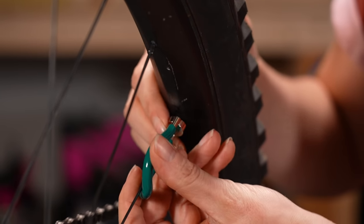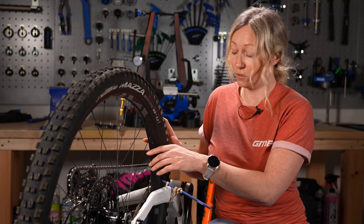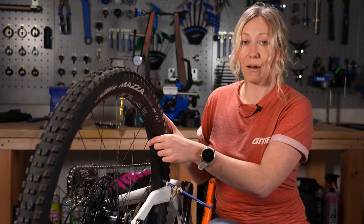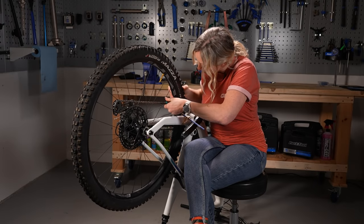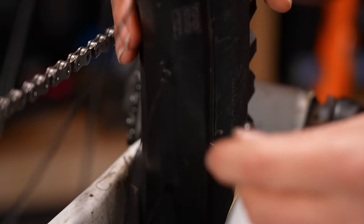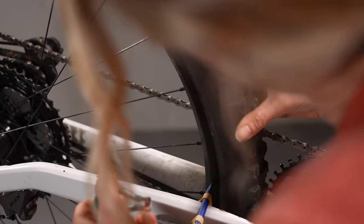Tightening that up half a turn was enough to move it away from the pencil. I'd always do a quarter turn or a half turn if there's a lot of movement, but it's better to go with a quarter turn first, then roll it back to the pencil and check if it's still scraping. If it is, carry on in quarter or half turn increments so you don't go too far in the opposite direction. This is the problem-solving part — checking whether it's going closer to the pencil or further away, and making tiny adjustments to straighten it up. A little backing off on that side, and the pencil shouldn't scrape anymore.